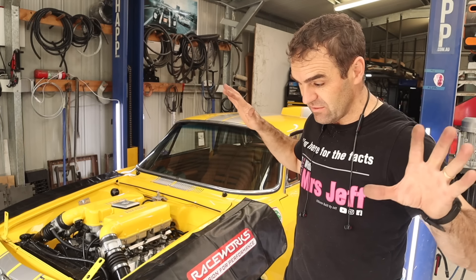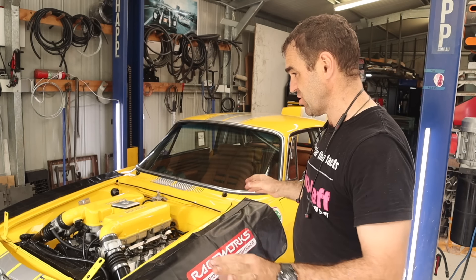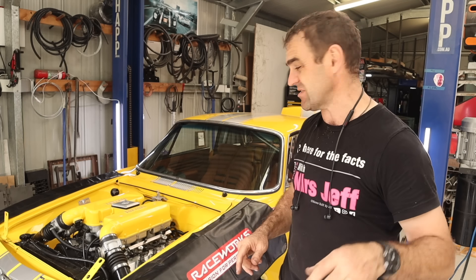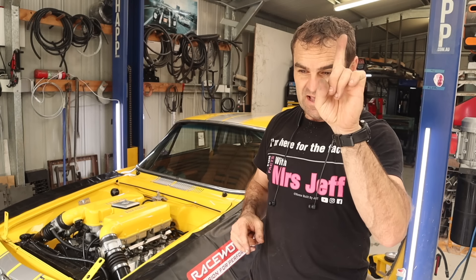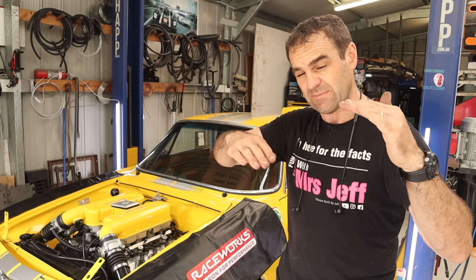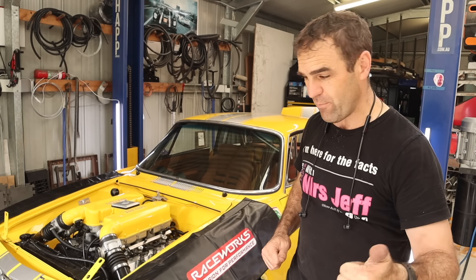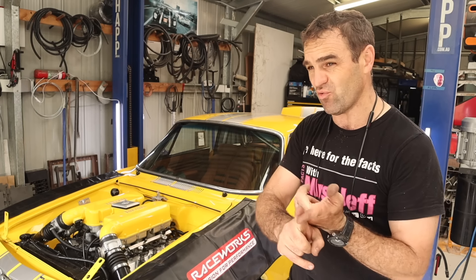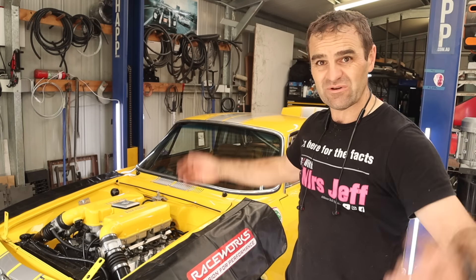We're all back together again. I want to get it up in the air, do one final nut and bolt check, make sure I've got everything right. I've topped up the coolant and topped up the oil — I put a little bit less oil in this time because of the earlier issue. I'll be carefully watching the oil level in the dry sump tank. There are fail safes in the ECU so if it doesn't have oil pressure it will basically die. Let's see what it does.